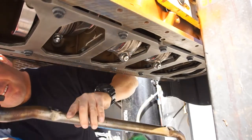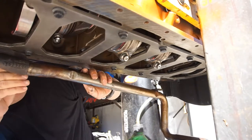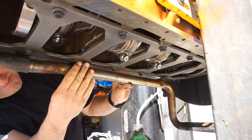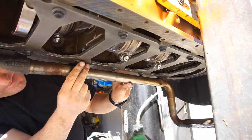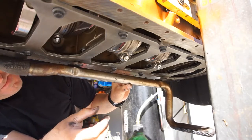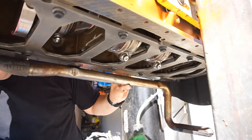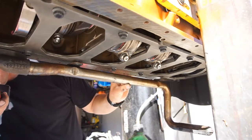Okay, let's stick this pickup tube in here — it still has the gasket on it. I'll torque that back down; if I remember right it was 18 foot-pounds. Well, my first issue already — the pickup tube is going to be a little different. There you go, problems with swapping parts.